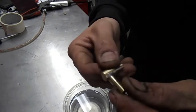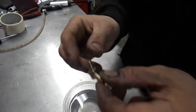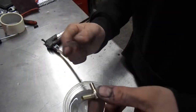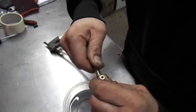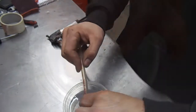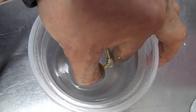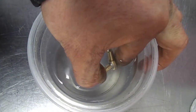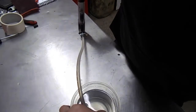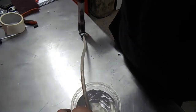I've just given it a little clean off. It looks all right, it's not brilliant, a little bit messy, but as long as it doesn't leak then I'm happy. So what I'm going to do now is test it by hooking up to a bike pump. I'm going to put my thumb over the other end, put it underwater and put a bit of pressure in there and see if it leaks. There's about 60 psi in there at the moment and there's no leaks, no bubbles coming out. And then if I let go, loads of air should come out - yep.